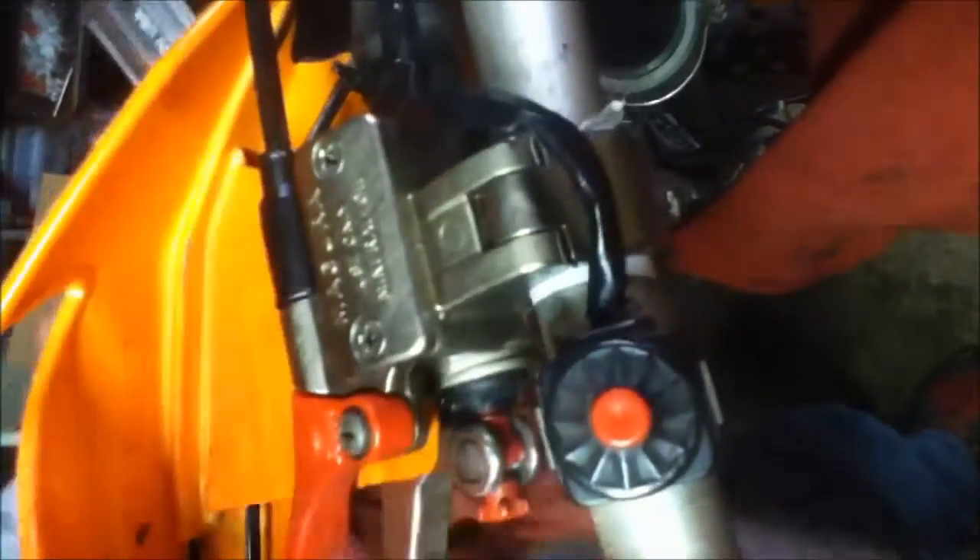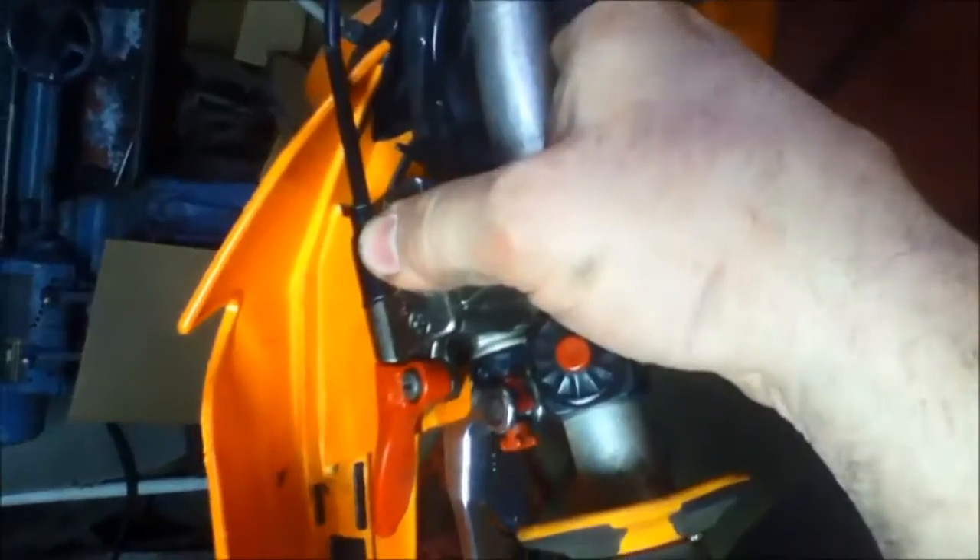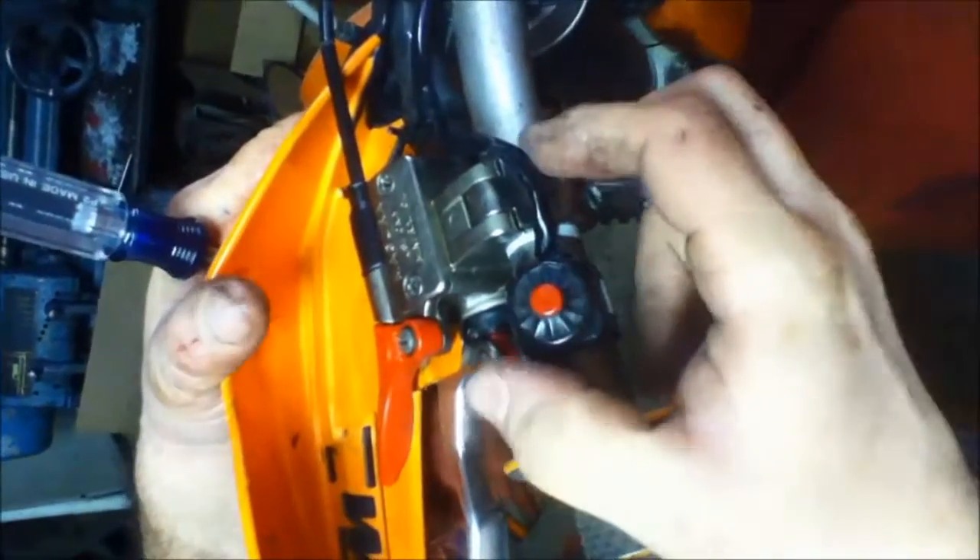See, there's plumber's tape underneath the bar. So now when you hit your handlebar really hard, it'll bend out of the way and you don't break your handles off. Make sure this is tight enough to hold it in place, but not so tight that it won't spin.